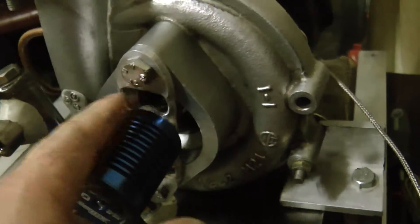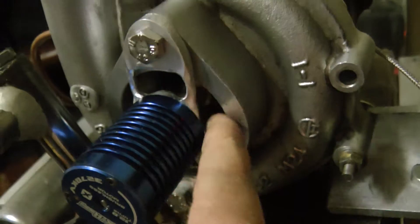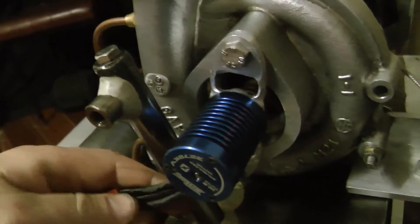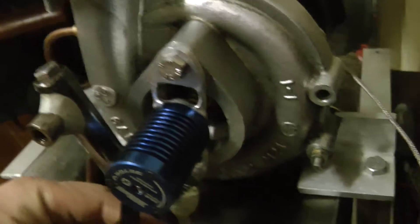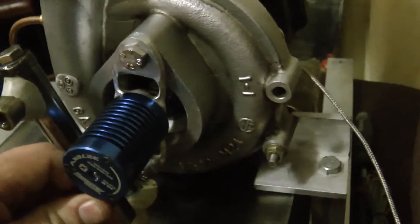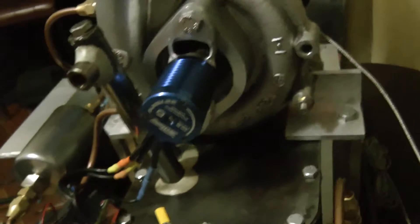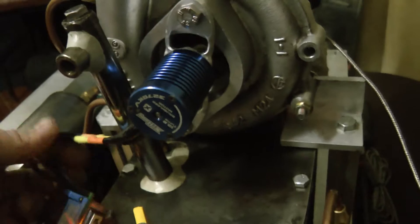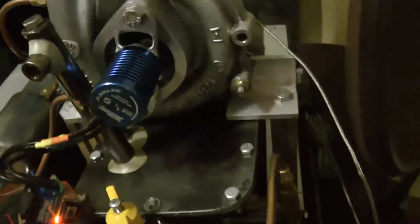It took me quite a few hours to file all of this to a smooth sort of edging. I'm going to run an air filter over the top of that — a big six cylinder car air filter. A lot of people say that it'll choke it up, but come on guys, we're not running high performance drag strip stuff here. This is for a motorbike.